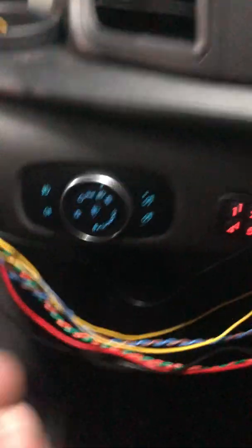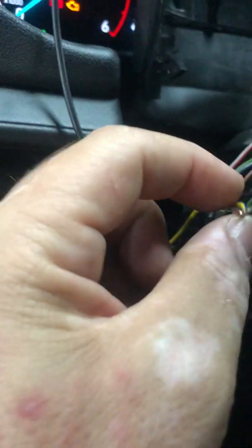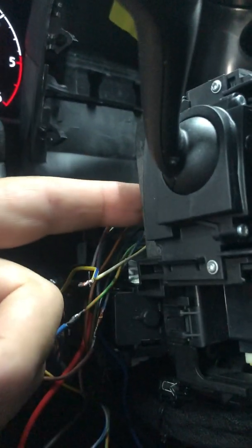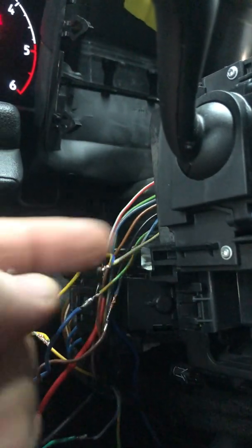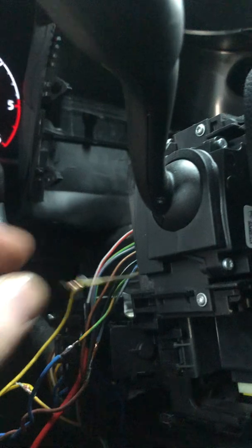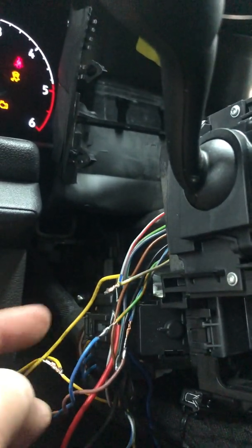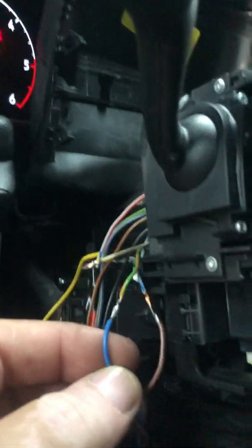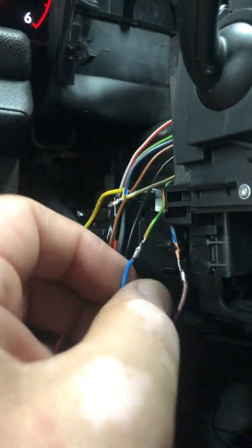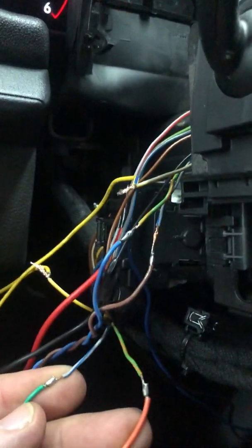What I'm going to show here is just here. So for the factory, this is the factory line going to the connector side here. This is the module. So we cut the LIN line and it goes to the gateway, and this is the other end after cutting. So we ended up with dual LIN. The CANbus is the same. We cut the CAN because we need to do the turn signals, wipers, and cruise. And the other line, after cutting, we end up with this line.